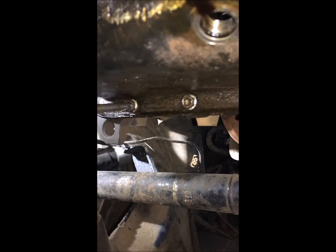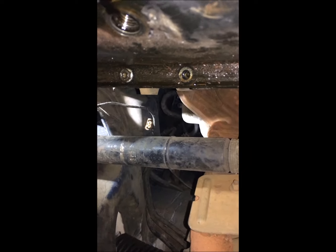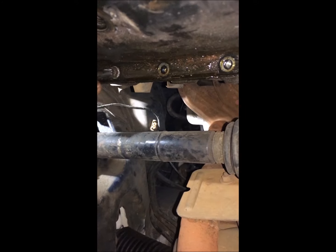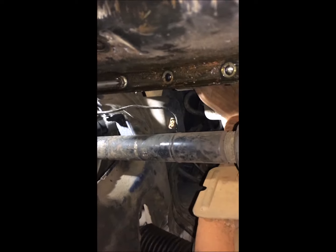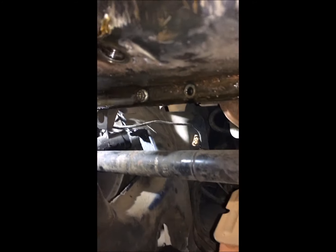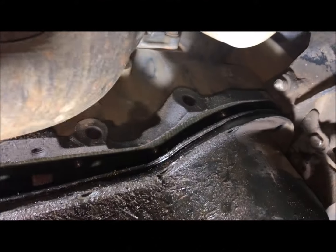Once I've got these two out, the oil sump will come off and then I'll replace the gasket. Especially for low riders — if you hit your sump and it leaks oil out, you have to replace your sump, and this is exactly what you're going to be doing. You drain your oil, loosen the T40 splines, and then your whole sump will come down. The nice part of taking your sump out is you can actually clean it — sometimes there are little sand particles sitting inside that you can clean out before you put your oil back in.